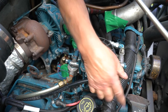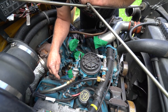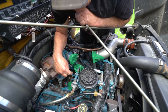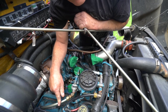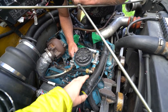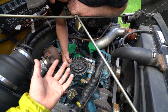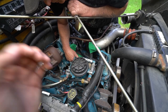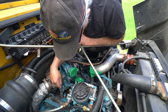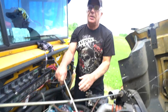We're going to put a valve here to control the fuel coming in and a valve on the return line. The reason for the one in the return line is: when you're running on veggie and you want to purge it, you switch to diesel — diesel fuel goes into the engine and you purge the veggie oil back to the veggie tank, not the diesel tank. For those who don't know, purging means getting all the veggie oil out because when it sits and gets cold, it thickens — and when vegetable oil is thick, it's really hard or impossible to start. So we're going to plug this filter housing and get rid of it. One question I still have is: when we're running on veggie, what's the pump doing? Is it sitting there turning, chewing itself up? Nobody can tell me that, so we'll get rid of it.